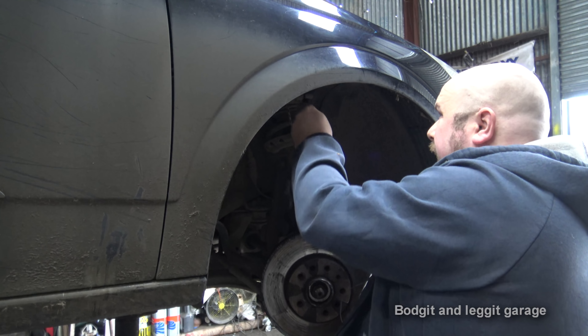I'm just going to give these a quick clean, butter them up with molly grease, then put the clip back on and this side is done. As you can see that's all been cleaned, looking good. Get some molly grease, pull it all the way over, put it in, and there we go. Do the other one, tighten them up, put the two little dust caps back, and put that clip in here and we're done.